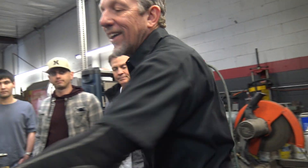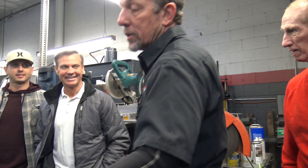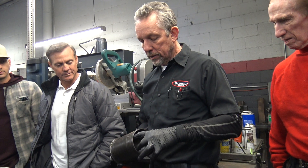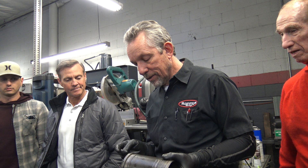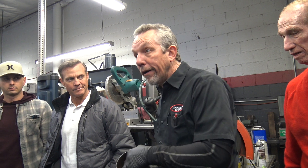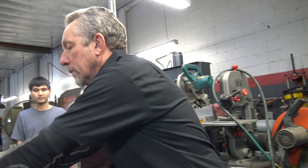So to get the sleeve to fit, what tool is he using — is there bench grinding to get it to fit when you're talking about the depth? No, we use a lathe. It's kind of time consuming because we chuck it into the lathe down here where there are no rings hitting, and then you've got to square it. It's hard to get them really square. Once you get it squared, you get it touching and then cut a thousandth off — a thousandth isn't very much. Then you take it off, fit it, and find out you didn't take a full thousandth off. So you put it back in the lathe, square it again — and that's why machine shops get so much money. It's setting stuff up.